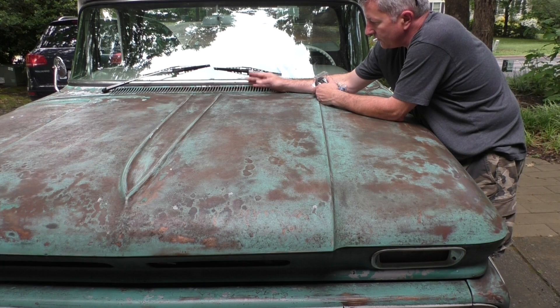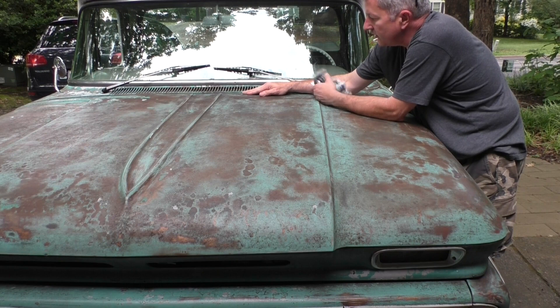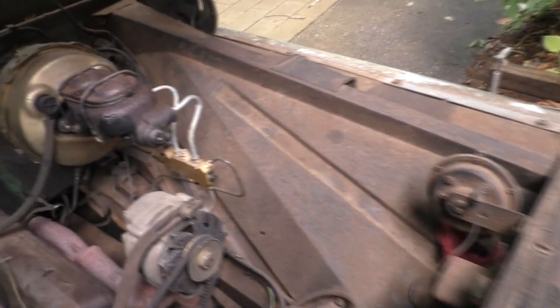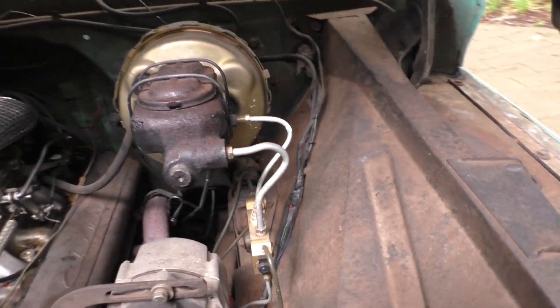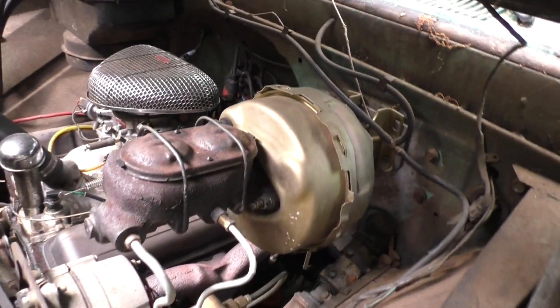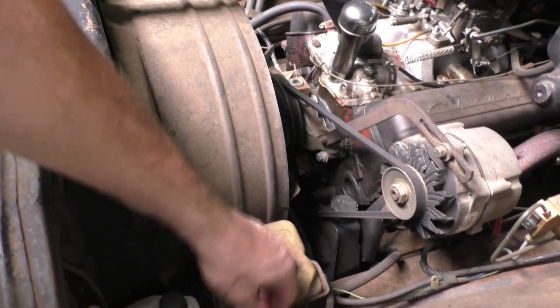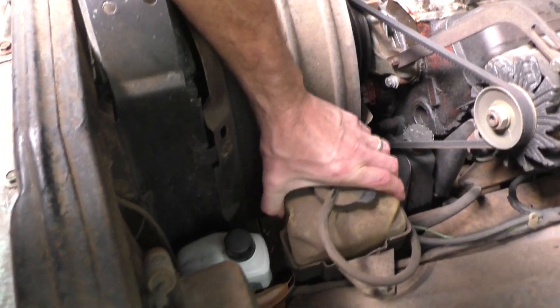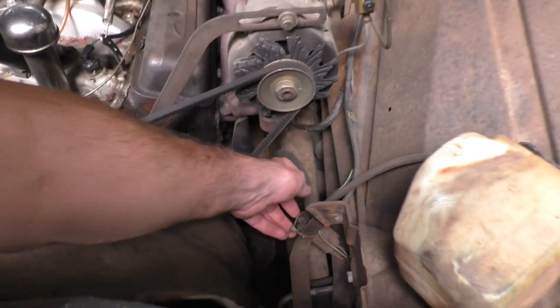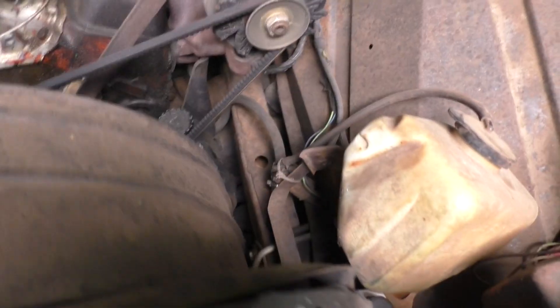I eliminated that years ago because it didn't work - it was all dried up, falling apart, couldn't find parts. I put an electric one in, and it's since died also. So we'll try to get this generic one in there in place of the generic one that's already there. Originally the windshield washer bottle lived up here somewhere, but I added a power brake booster which was not original equipment. I modified the bracket and put the bottle down here next to the radiator, and also moved the pump down here, and it has quit. This ought to be a pretty easy, quick installation.